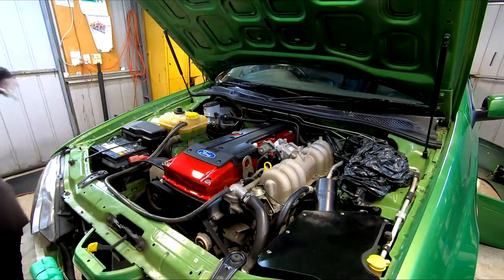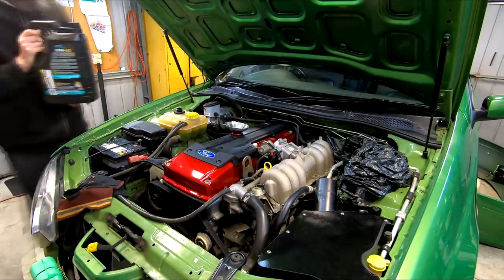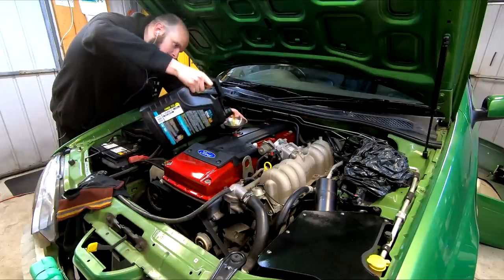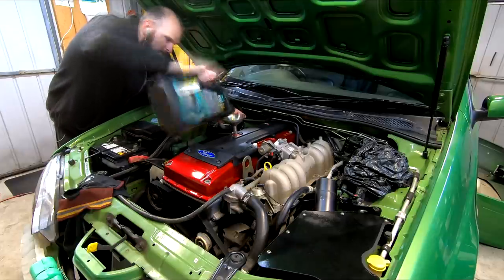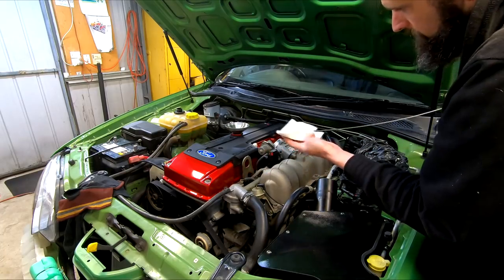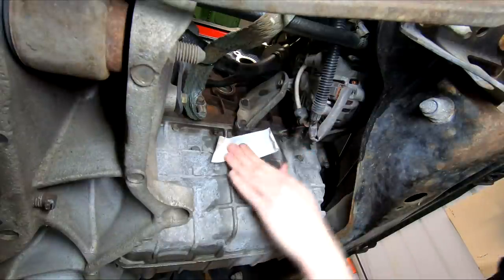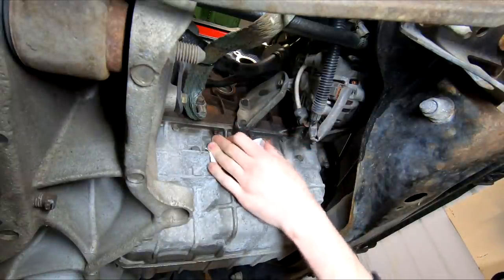Once that's done, I've dropped the oil, then flushed it through a few times more to collect any hopefully very little metal that made it into the pan. This could be done with old oil if well strained, with new cheapo oil, or it's even been suggested that some diesel might be good for this job. Only one little piece of metal has been strained out using this method, which pretty well reflects my testing results. I've left the oil filter and filled the engine with some good clean oil. We'll run this car very briefly, then do another full oil and filter change. We'll wait until more is on before fitting the oil return line — I've left tape over the opening for now.